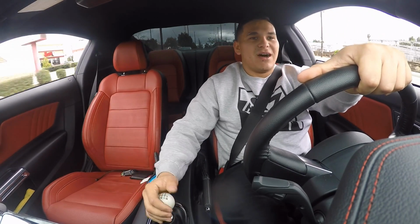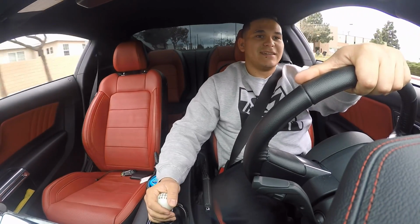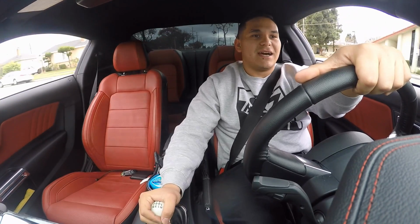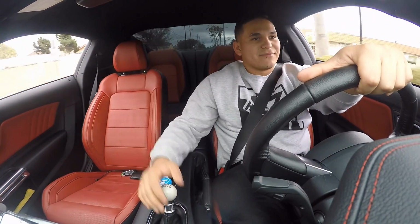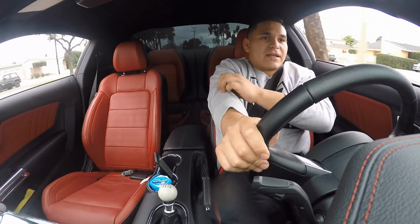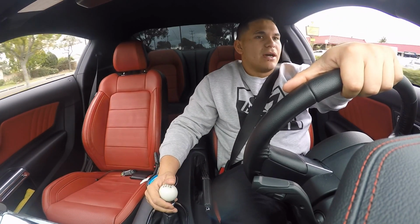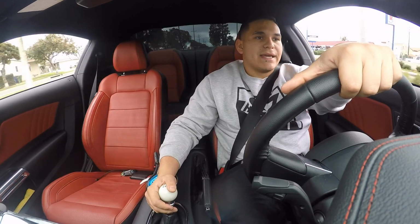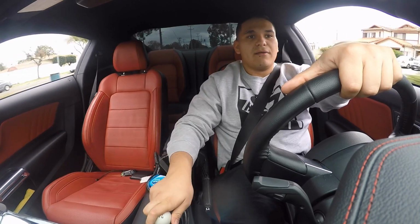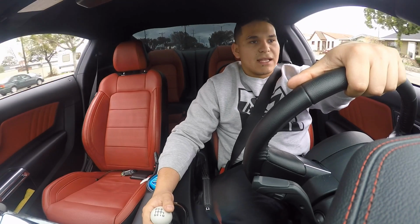So you see, I wheel hopped completely out of first, completely out of second. I completely wheel hopped, there's no doubt about it. I was getting sideways there. But like I said, the fact that it rained earlier doesn't help. I'm sure that's what it was, because I usually only get wheel hop out of first. Usually by the time I'm in second and third, I'm good. And again, hopefully that alignment will help a little more.